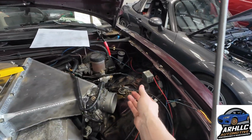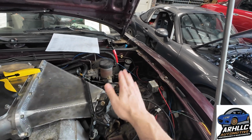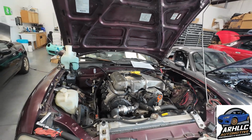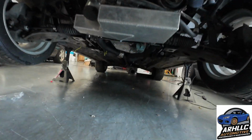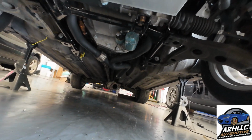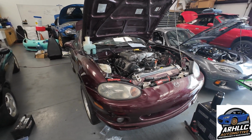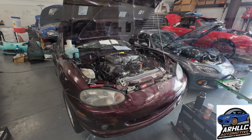We got in our MAP sensor connector. The problem has been that the wiring over here doesn't have a 5-volt or anything. We're currently having MAP signal problems, trying to figure that out. And then the IAT for some reason is stuck at really low temperature, if I remember correctly. There is a signal problem there too, so we're going to have to diagnose those. The exhaust looks really nice under there. We don't have it hooked up to the stock exhaust over there. We'll have to see what the customer wants to do. Meanwhile, we have fired it up, and it sounds okay. It doesn't idle the best. It jumps up and down because, again, the IAT and the MAP don't work.